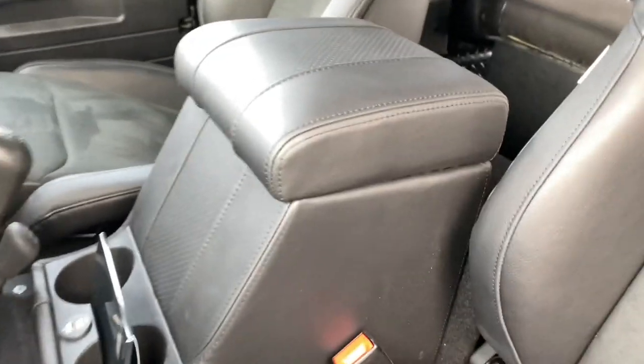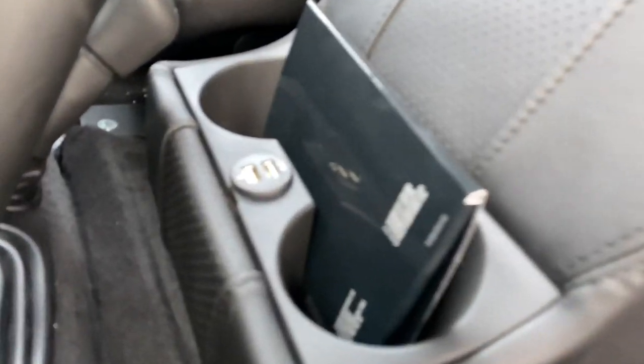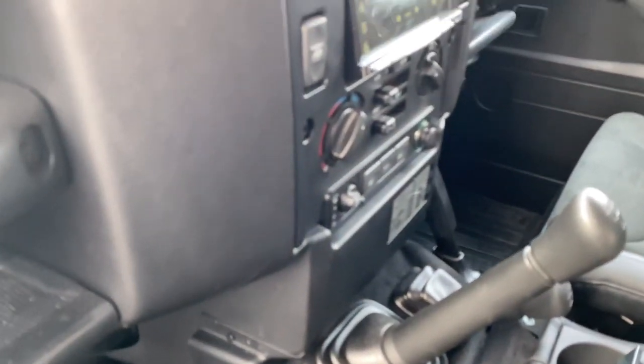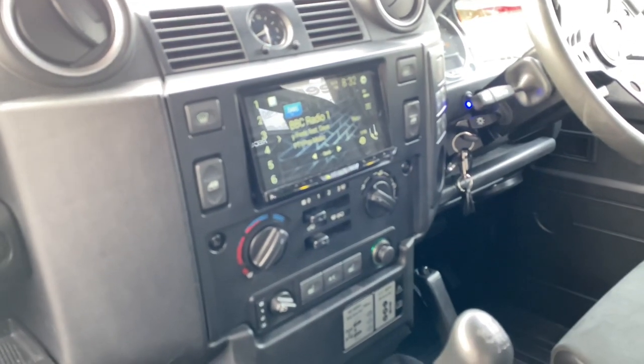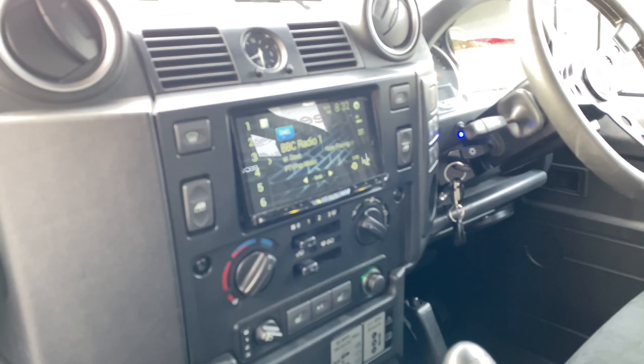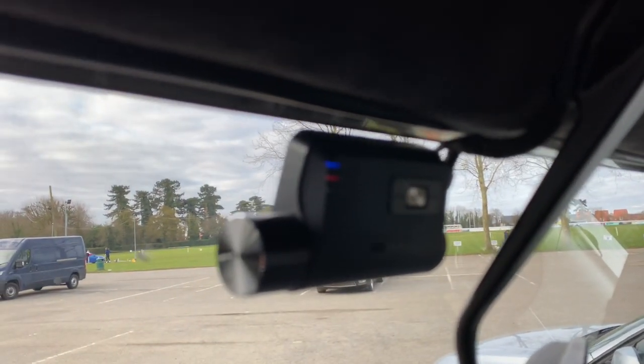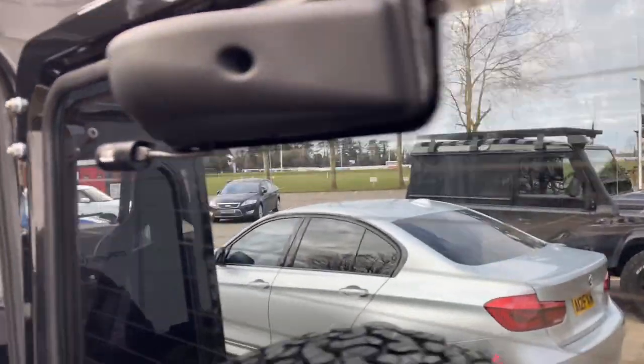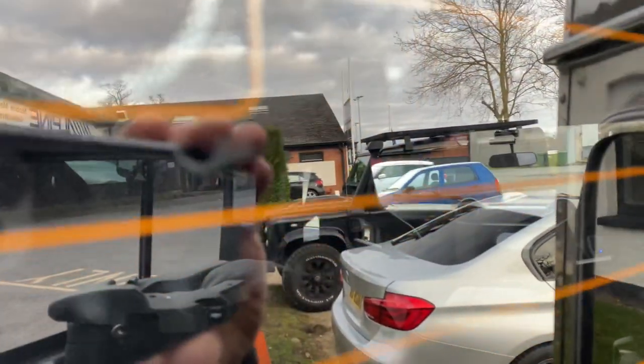We've done the high-rise cubby — popular upgrade because it's nice and comfortable. Done the twin USBs. This already had a double DIN navigation but it wasn't a very nice set, so we've replaced that with the Pioneer AVH-9200, which is the first one that gives you wireless Apple CarPlay, wireless Android Auto, DAB, etc. We've added front and rear witness cameras — Thinkware Q800 two channel — there's a microphone up top. The rear camera is placed in the swept area of the screen, cables are all hidden behind the trim and around the cluster, so from the outside you can't see it — that's how we want it to be.